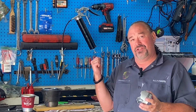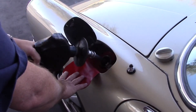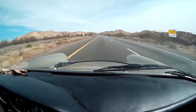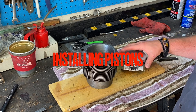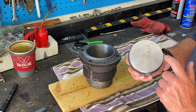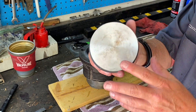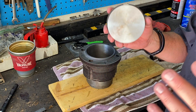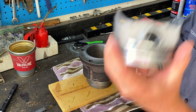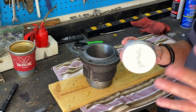Today we are going to check the ring gap in our cylinders, and then we're going to install the pistons into the cylinders and get them in on our '67 Porsche engine. Most Porsche Volkswagen pistons will have an arrow pointing to the direction of the flywheel, but this piston does not — that's because it's a Keith Black piston. Whether you're Porsche, Volkswagen, Corvette, or high-performance GM, Keith Black makes some impressive pistons. With that, we need to check our ring gap, which is a little different than most normal pistons in the Porsche Volkswagen community.